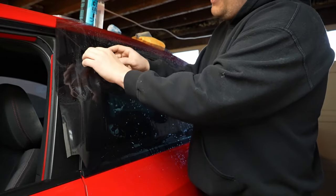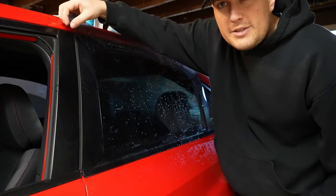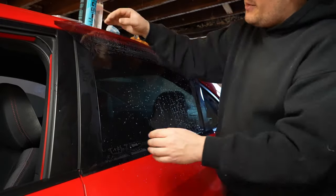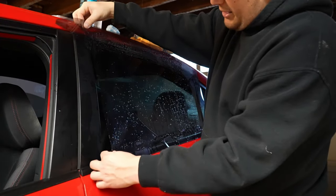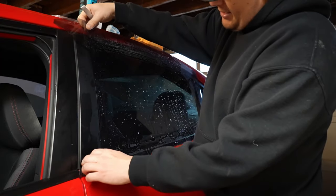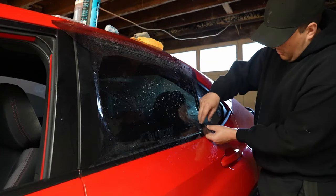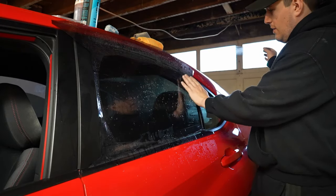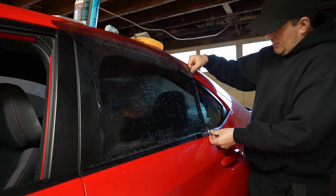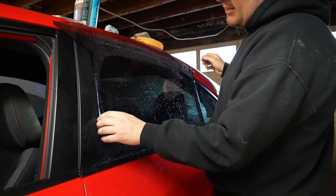The most important thing is this film does not move. So I'm spraying it down again, squeegeeing a little further out for maximum tack - getting as close to the corners without creasing the tint. One click on the blade, using my fingers to get out to the edge and push it down, using the gasket as a guide going down. Now I've got my cut. Blade goes in the pocket - you don't want to accidentally cut something. Starting at the bottom, I'm lifting the tint and tearing away. Once you start your tear, you're good - this is the easiest place to mess up. Grab the top and tear away. You'll have an extra flap - I'll cut that later. You want extra room because you have a gasket on either side. I'm grabbing the tint from top and bottom, lifting it, breaking the seal, and pulling it up and over - giving myself about an eighth to a quarter of an inch.